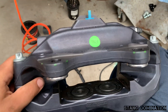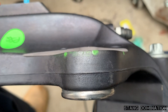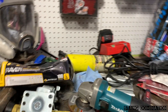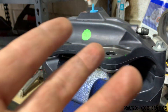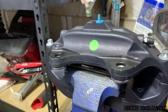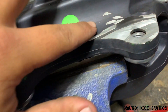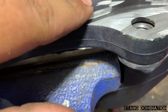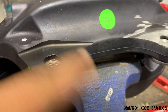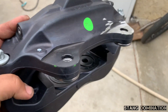I'm going to grind it down with the grinder until I hit almost the bottom of the green line. We're measuring from the inside on the flat surface — got 0.744 — and I need to get it down to the 0.6xx range. The difference of a few thousandths won't be huge, but if you've never done this type of work, I wouldn't recommend grinding it yourself — take it to a machine shop. The grinder can work but this is very thick material and it'll take a long time. I might just send this to a machine shop and have it done properly.